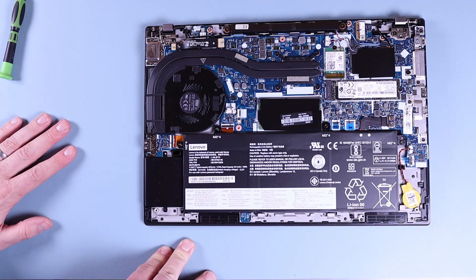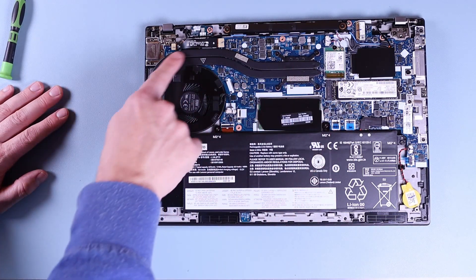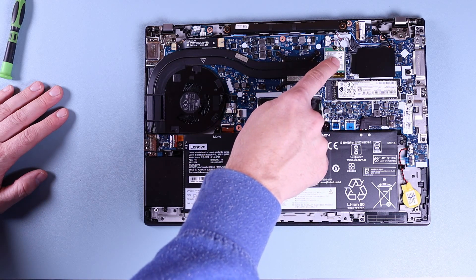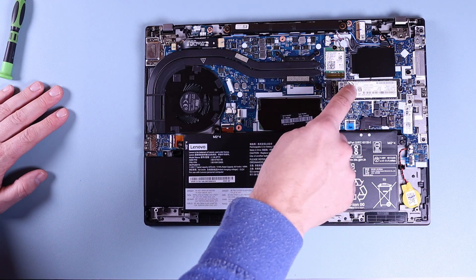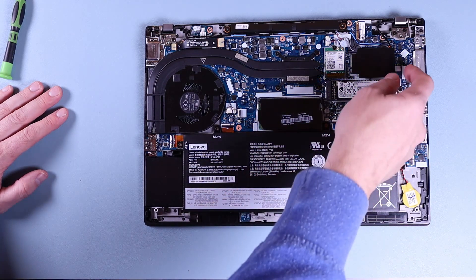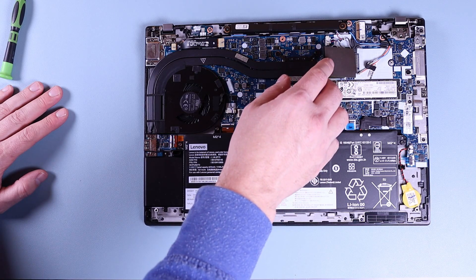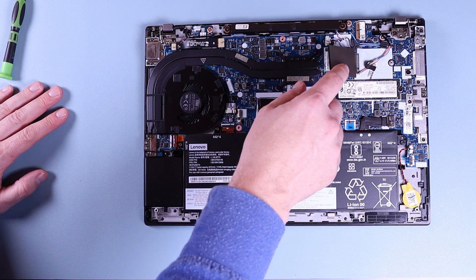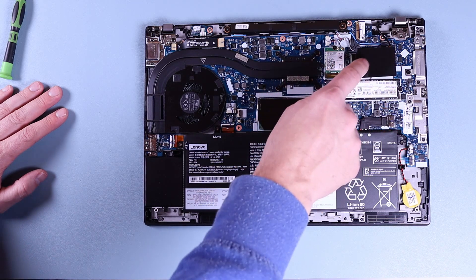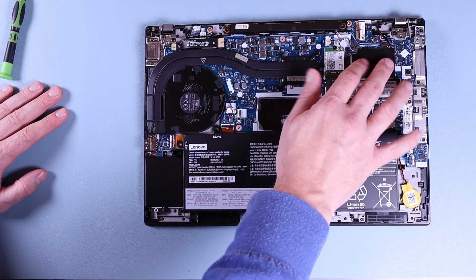So here we are inside the T14. You can see straight away there's the battery, there's our dual pipe heat sink for this Ryzen chip, we've got our screwed-in Wi-Fi adapter, my 1TB PCIe NVMe. Under here we have got the WAN adapter. I did try a couple of different SSDs with no luck — I tried a SATA and an NVMe 42mm and didn't get any luck with that so far. It's obviously a very specific SSD; some people reckon they've got it working, I haven't yet.